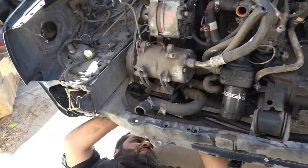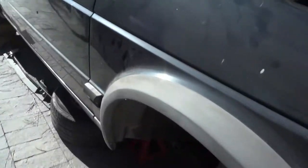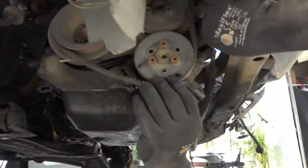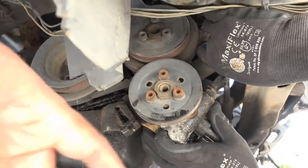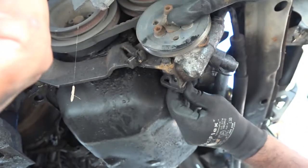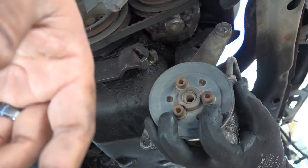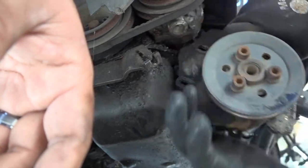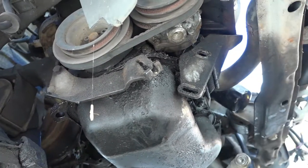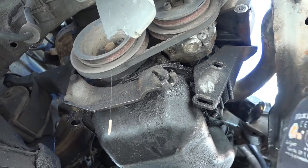To prevent a big mess, we're actually taking the power steering pump off. It looks pretty straightforward — just a couple bolts, looks like they're all 13 millimeters. You can see down here there's a 13 here, and then just turn here. This one's gonna have to come out. Take the belt off — there'll be one here. The tricky one is the back bolt that's up on top of the pump, on the inside. That'll keep it sealed so no power steering fluid gets anywhere.